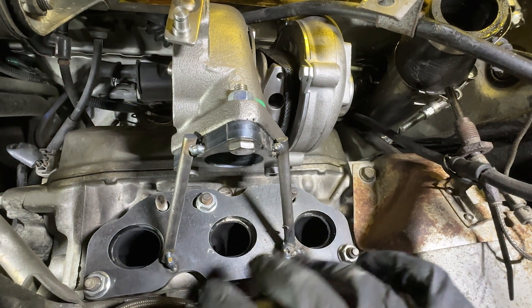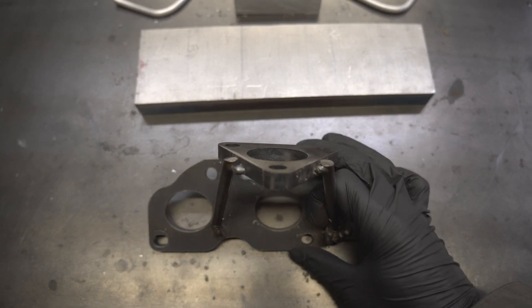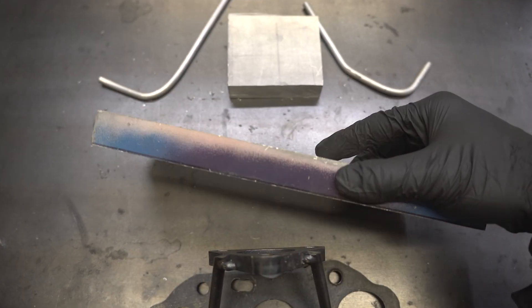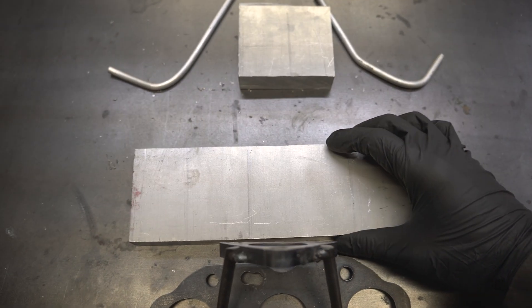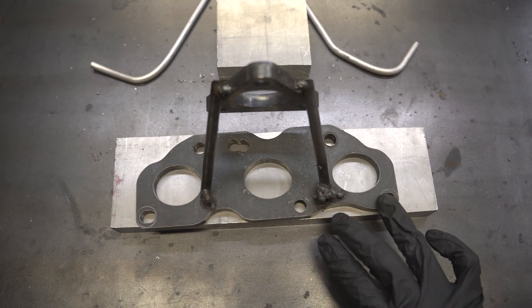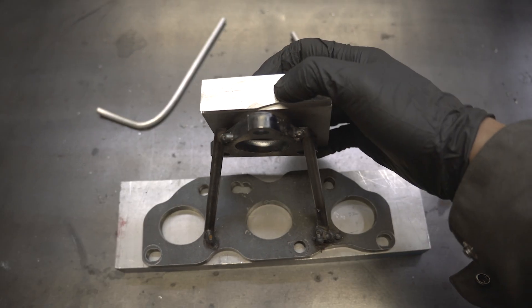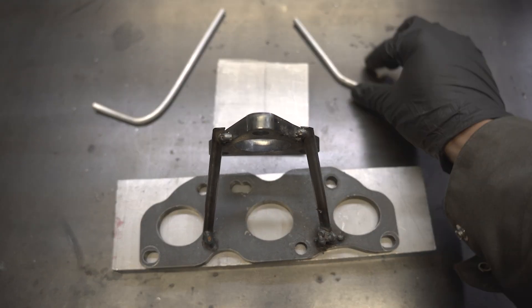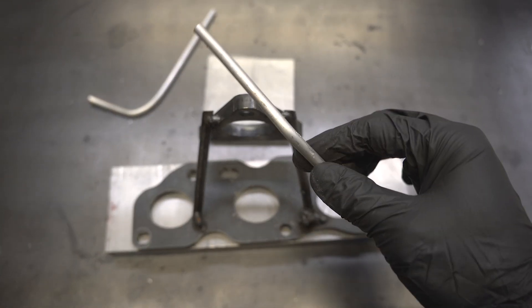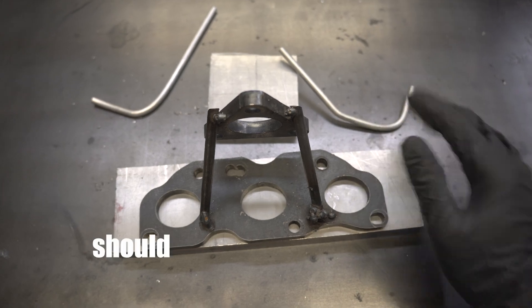I think I could go ahead and take this off and get it onto the bench. Before we start welding everything up, I'm going to make a jig using this guy, and I cut some aluminum blanks. They're super thick — about one inch — so I am going to position this on here, drill the hole so I could mount it with some hardware. Same thing with the turbo flange side, and then I'll connect the two pieces with these aluminum rods. I'm not sure if these are going to be sturdy enough, but I think it'll be okay with this application, and it's what I had on hand.